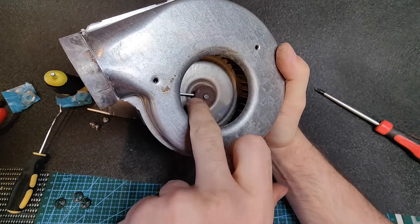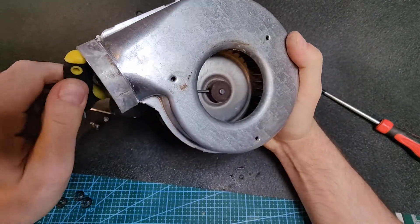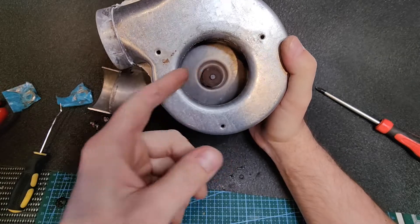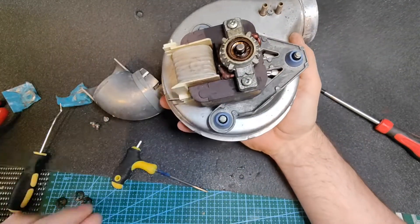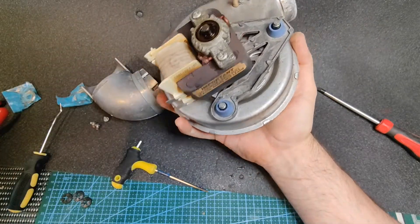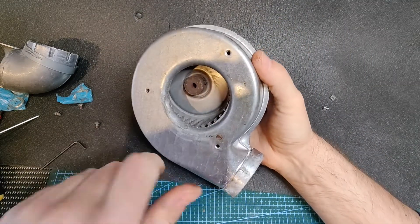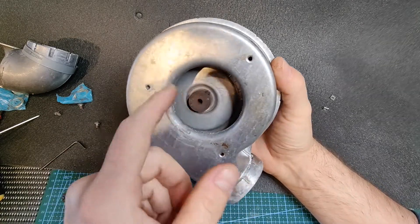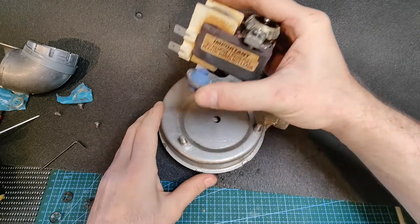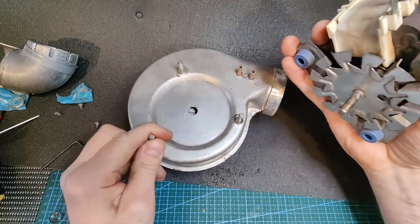There's a little key in there that's locking this piece onto the shaft, so you just want to break that loose like that and then that should come off. Once that comes off we'll be able to separate the top section. I've already removed the three spring clips, so once we get this bottom piece off the whole top piece will come out. I've managed to loosen the allen key and twist the blower fan off the shaft itself — it's all completely separate now. Since I took the spring clips off, this whole unit lifts away — and there we have it, that's the entirety of the motor.